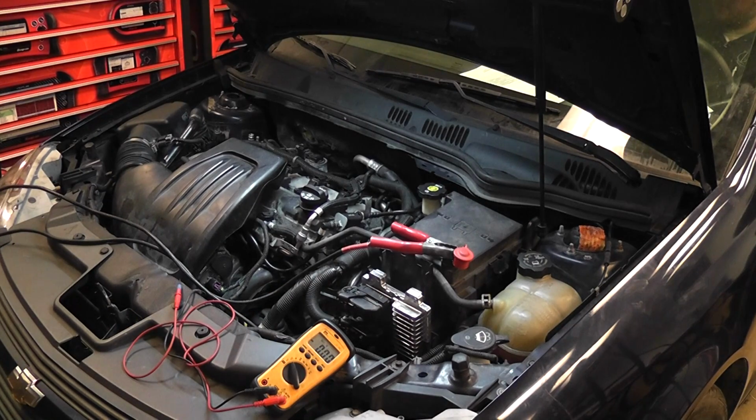Anyway, it was the right call, but now the car is back, and I was just told that it doesn't start. It cranks now, as you just heard. It starts and runs. Can we get an exhaust hose on this? Because this thing, I'm sure, is going to stink. It is saying on the dash, engine power reduced. There's a message on the dash that says engine power reduced, and that's probably because I just unplugged the throttle body, the drive-by-wire throttle body unit.